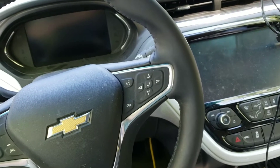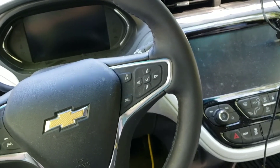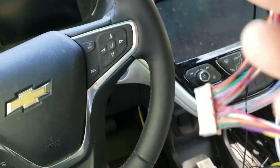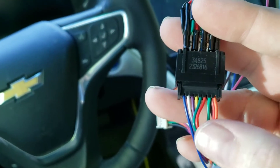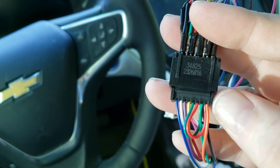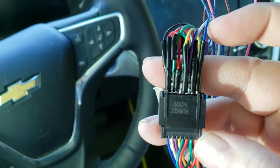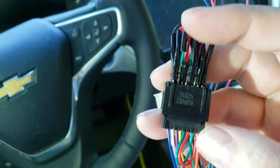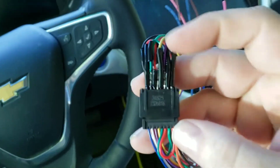We tested the new harness and it didn't work — it didn't work spectacularly. That is because I have it wired in reverse. The female connector is right — that's pin five. This is pin five, but see how these wire colors are backwards? Got the blue over here, got the white. It's just completely backwards.